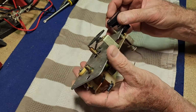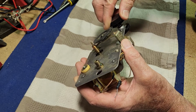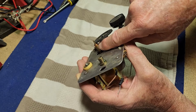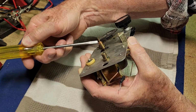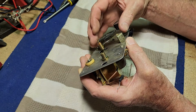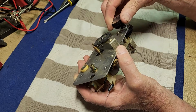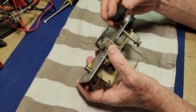We can see the wheel on the top of the spindle, and when we select 33, it's on the middle part of the spindle. So it doesn't actually run on the bottom. That would be too fast. So we have the first speed is the first section, and then the top section is the second speed. And there's not a lot of difference between 33 revs per minute and 45 revs per minute. So that's working perfectly.